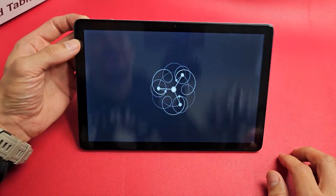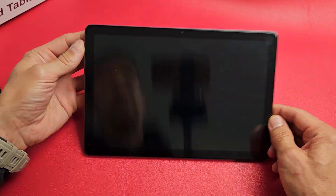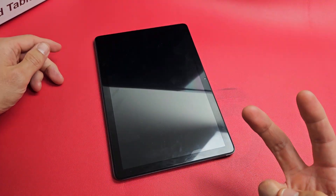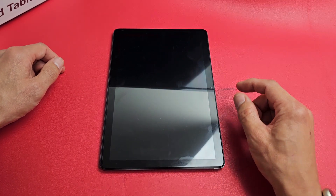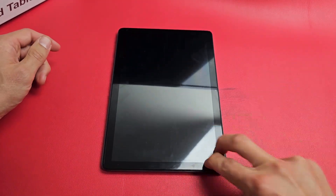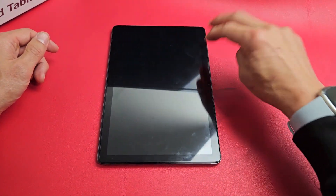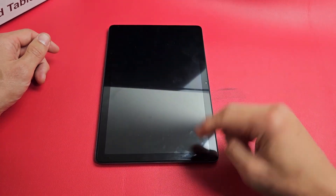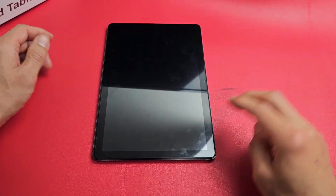If your screen is still black, the next step is what I call the tap method. Get two fingers, lay your tablet down, and tap everywhere — kind of hard. The whole premise behind this is you may have a cable that's slightly dislodged, and a little tap can pop it back into place. We'll start on the screen here. Tap all over. Sometimes as you're doing this, the screen will turn on, or you might get a white line, or half the screen may pop on. Keep going, then tap the power button and see if your screen is on.